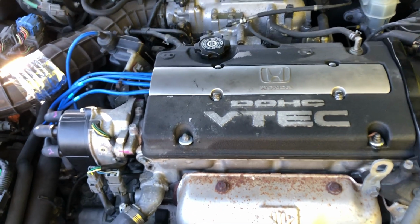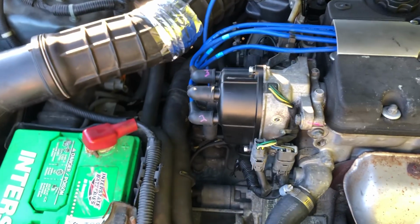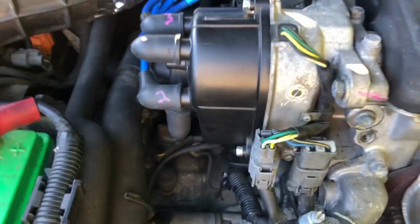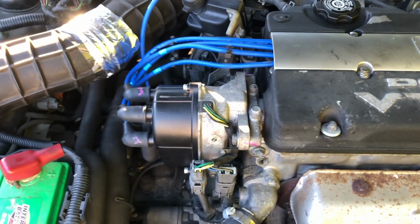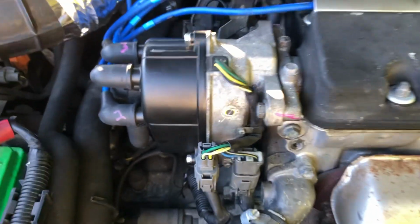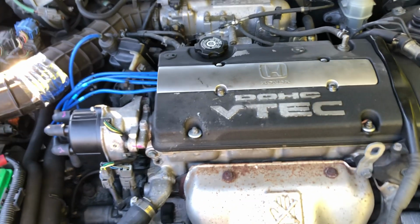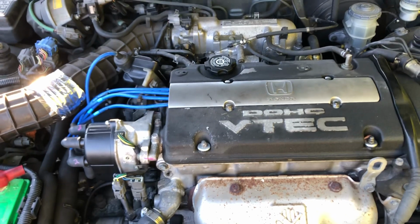But what I had done was change the distributor cap and rotor, and I'd put in a Chinese distributor cap that didn't even fit flush. It just looked off. So I pulled the Chinese one off and put the original one, made in Japan, back on, and it fits all nice. I left the rotor in that I'd replaced, gave it a little tune up, and sure enough, it fired right off.